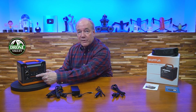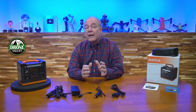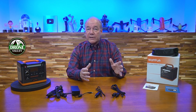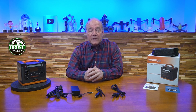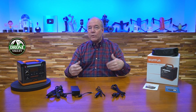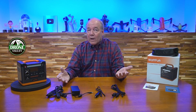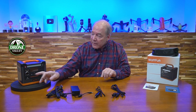The third USB port is a USB-C connector, which is the latest standard for USB charging. It's not only USB-C but also PD — power delivery — which is another form of quick charging. If you've got a drone controller, drone batteries, or a laptop that can take advantage of PD, plug it in and that port negotiates the right voltage and current to quickly and safely charge it. It's a 60-watt port, so it handles large, thirsty devices like laptops and drone batteries.